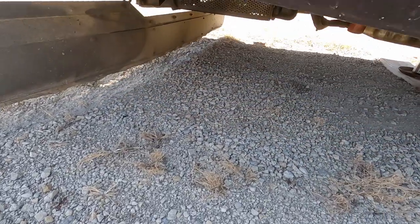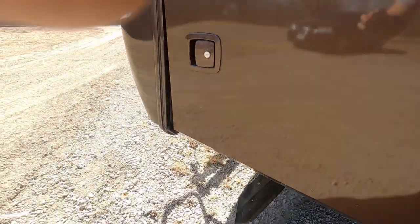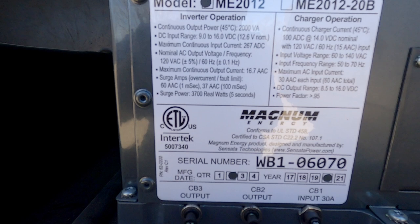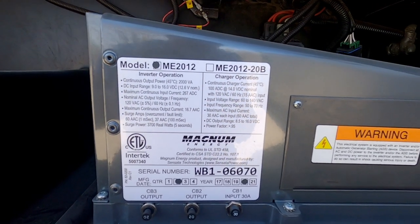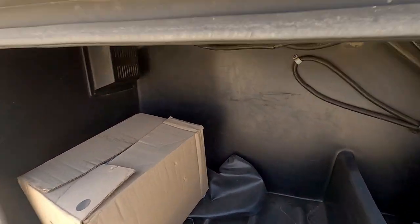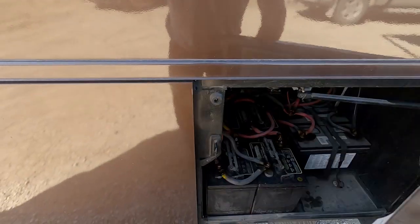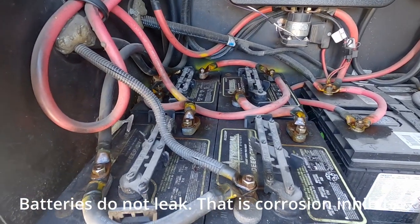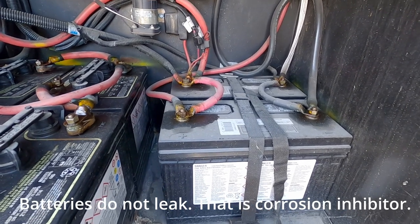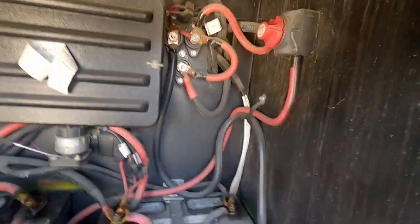Touch back here — you have a good inch of tread. A little protector for whenever you've got a pull-behind. Got a Magnum 2000 — 2000-watt inverter with new controllers. Extra space — does have a cover for the hitch in the back. All your batteries: four six-volt batteries for your home itself, and then two twelve-volt, 1000-amp batteries for starting your engine. Got disconnects for both.